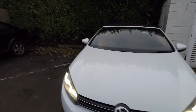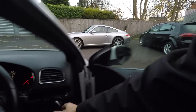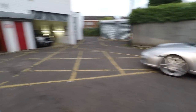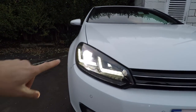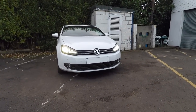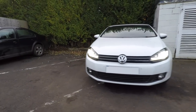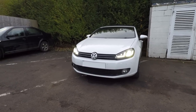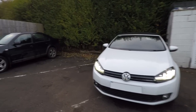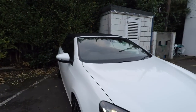But it's not all about the daytime running lights, so let's get it onto dip beam. This is what you drive on normally at night, and I'll show you where you're going to really see benefits driving at night. So in the top left hand corner there, we've got the HID section, and that's got a xenon bulb which gives a lot brighter, a lot whiter light than a normal halogen bulb, and gives a better spread of light as well. So if you're driving a lot at night, so you're commuting, then not only do these lights look cool because you've still got the LED bits on, but you get the benefits of a Xenon conversion as well. And it's perfectly legal because the bulb doesn't produce enough light to require headlamp washers and the self-leveling which some factory systems come with.